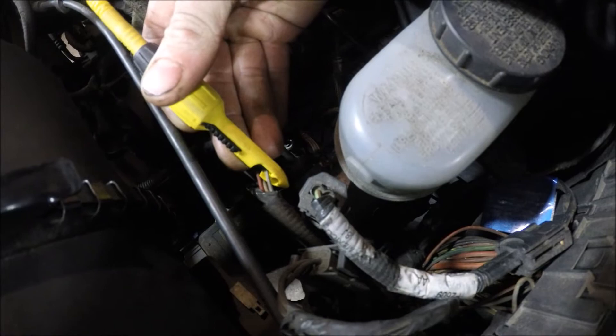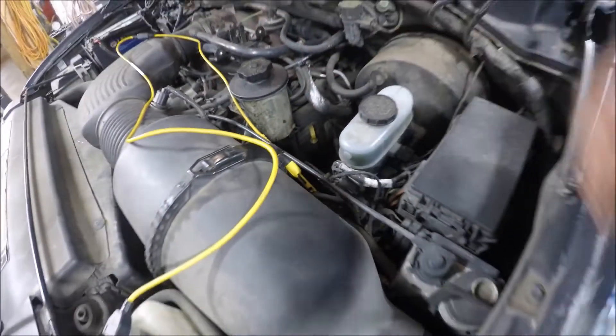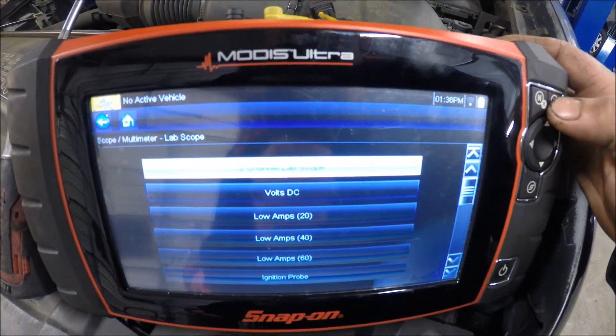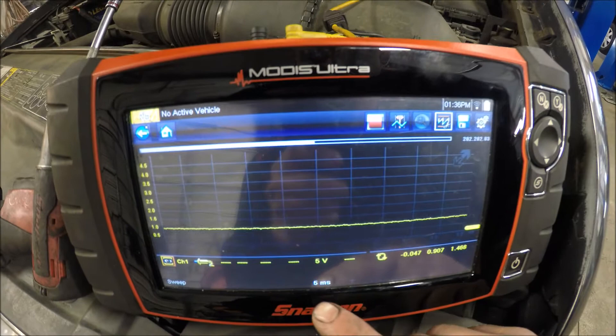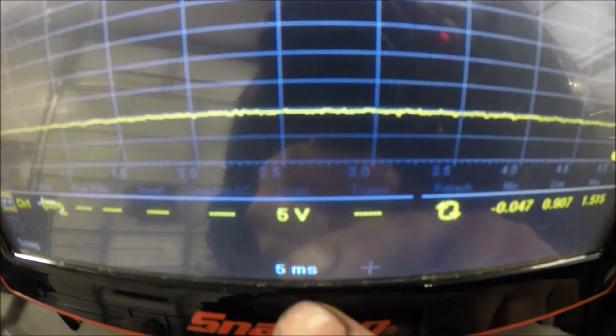I get right here on the green wire, which is the signal wire that responds to the PCM and reads airflow. Then I come in here, go up to two-channel, and you want to turn the cycling speed really, really fast.